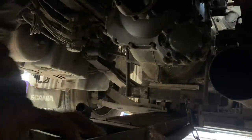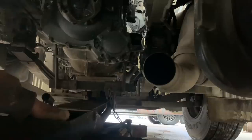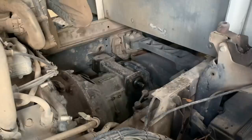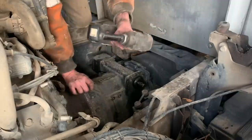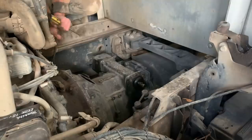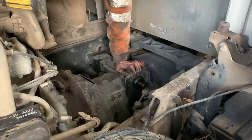I've got a bit of pressure on them. Right, now we'll lower it down. Take the bellhousing bolts out. Come join me at the top as we remove the last of the bellhousing bolts. Now we should just pry bar that out. I need to go down with my jack so I'll slide around.